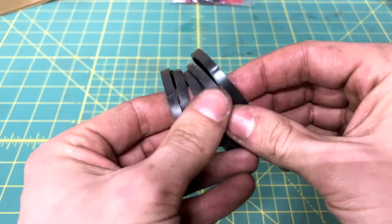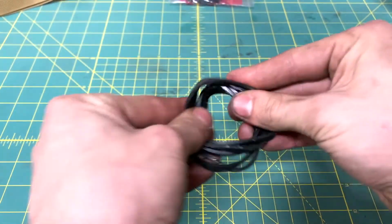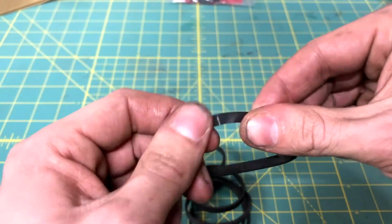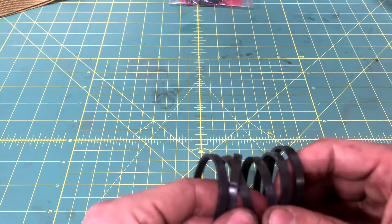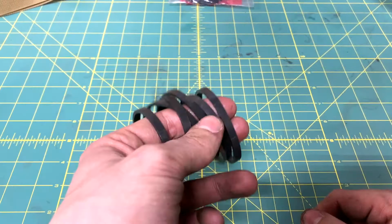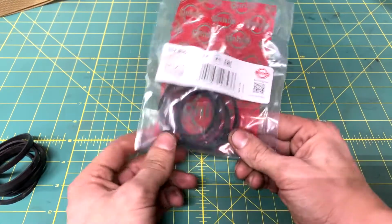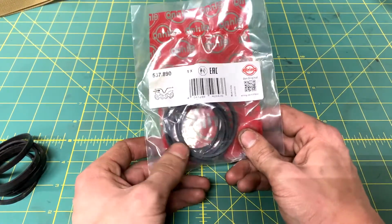Here are the 6 original intake manifold runner gaskets. They are still pretty pliable, but they're not great. And it's probably a good thing to replace these now that the car is, what, 13 or something years old. Another thing I noticed is that there's a ton of oil in the intake runners, which means regardless of how this magnesium valve cover job goes, I will be keeping the catch can, that is for certain.